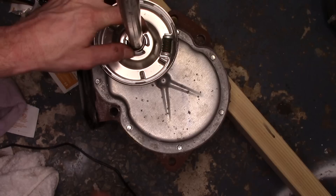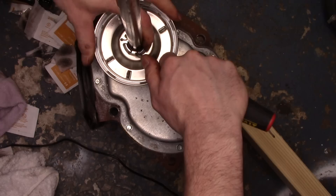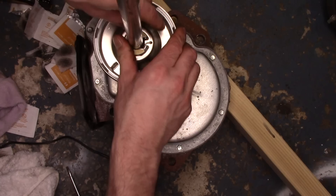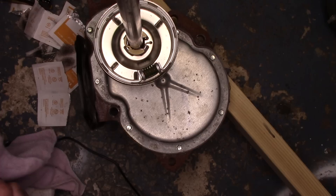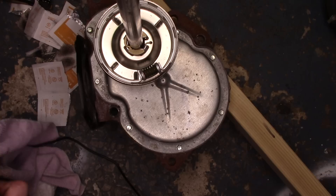Now we'll put the retaining ring back in — this one is a little tricky. Get it started, then use a flathead to push it the rest of the way. You're probably not going to get it on your first try. Then put your C-clip in and the cover. Make sure you don't get greasy hands on the clutch pad assembly because if you get it greasy it's going to start slipping, and your washer won't spin well. You might think you installed a bad clutch when you actually just ruined it by getting it greasy — it's like putting oil on your brakes.